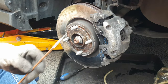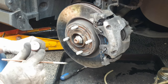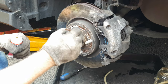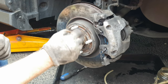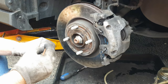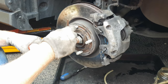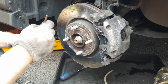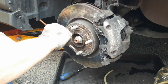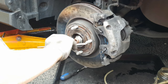Make sure that the spring is pushed fully home in those holes. From the factory the studs and all this mating face come dry with nothing on them, so you could put a little Ceratec around this flange — because that's the flange the alloy fits to very closely — and also a little bit of Ceratec just in the threads; not much, just a little. Again, don't use copper grease — it dries out and causes the wheel nuts to get stuck onto the studs. This stuff won't dry out.